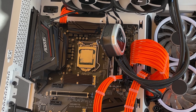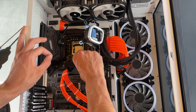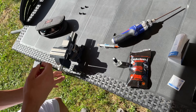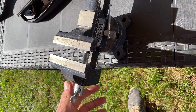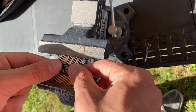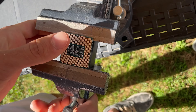Now, I was thinking we should probably delid this CPU, because we're gonna get huge performance gains by delidding it, so I think it's better if we do it. Here we are with this Limited Edition i7-8086K, and we're gonna delid it. So first of all, we're gonna take it out of the socket without bending any pins. Now we're gonna move over to our vise right here, and it's just a matter of opening it up. I have a tutorial for this on YouTube in case you want it, but you just need to align the CPU and the PCB itself on the other side — kind of like this. Then you align it exactly, and at this point you just apply some force, and it's done.